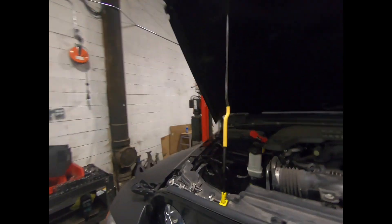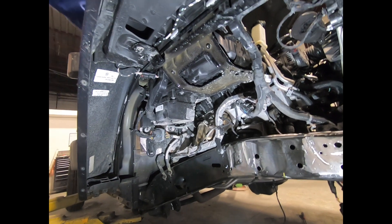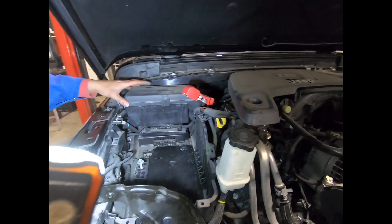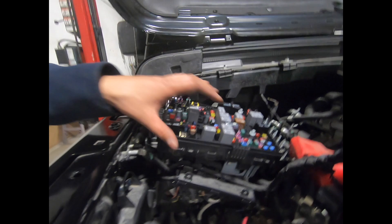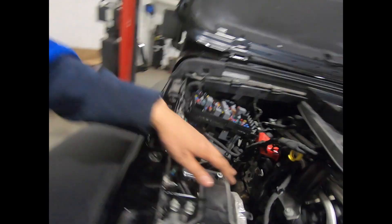Let's see what army is doing on the other side. That bracket has to come out — they really went intricate with these. So we're gonna take out this whole bracket, keep the fuse box there. After about a good hour we finally got this one out. The good news is we can still use the back half and it'll be supported, but we're gonna have to cut this bracket out — just grind these welds down to get rid of this and then we'll have more room for the control arm.